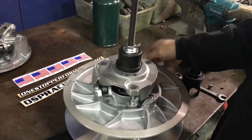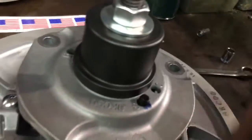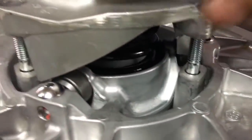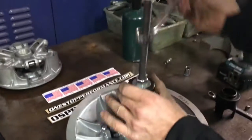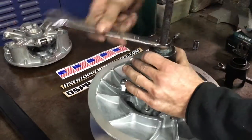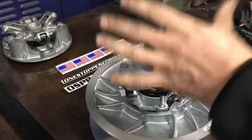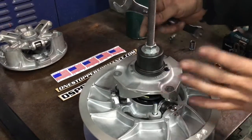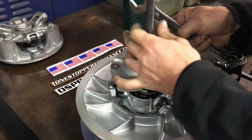As you can see, it just drops right out. Now you want to note where the springs are located. You can see we've got one mark here and the other tang is over here — we've already got marks on our clutch. We want to make sure we mark that so we know where we were to make a change. Hold your hand on this, because once it's unsprung, that is crucial. If you put it back without any twist, or with it twisted the wrong way, the converter won't function properly. You need to note the orientation of how the spring was wound up into the cover.